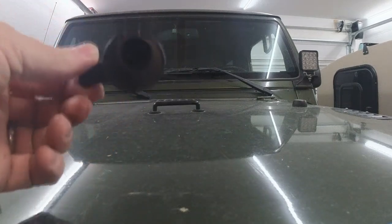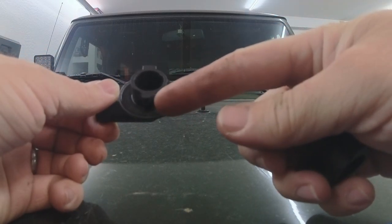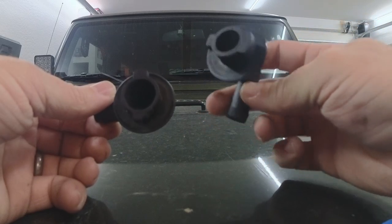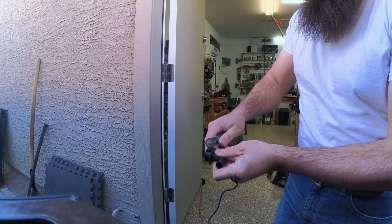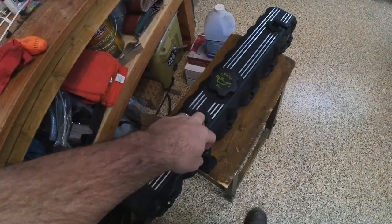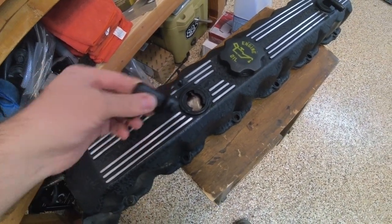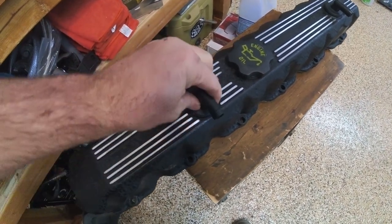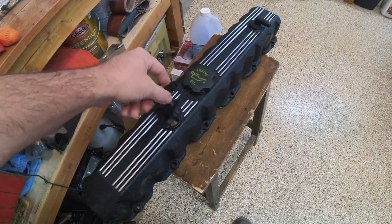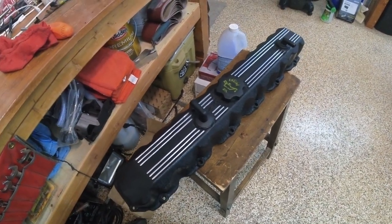I have two of these. This is the front one — this is for venting, it lets air in. This is the replacement one. I did practice on this one, just kind of with a knife and broke it, but I can put it in there reverse because this elbow points the wrong way and still twist it and it works. I got to modify this one real quick to fit. Here's my modified product — you can see inside there there's a shield, a deflector. The hope is that as oil comes up, it hits it and just kind of runs back down. In the past, this thing inserted this way and rotated to the right, going to the intake on an XJ or YJ on the driver's side. For me, I want it to go the other way — now I can go that direction, and it goes to my airbox.